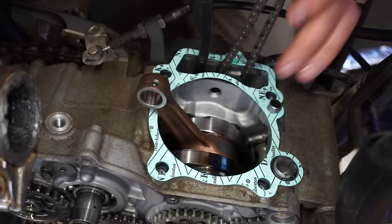We're at 110. Yeah, 110 PSI, that's pretty low. This thing should be a lot higher than that. It should be over 150. So that could be our problem. All right, we're gonna do a leak down test with it.